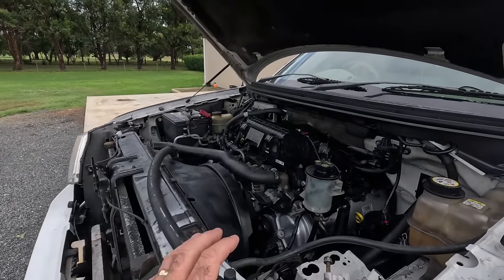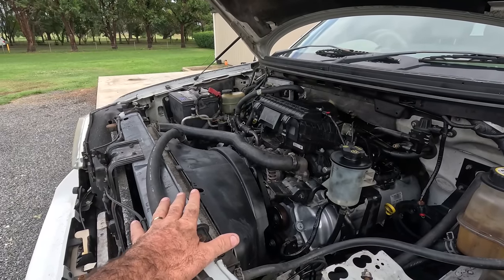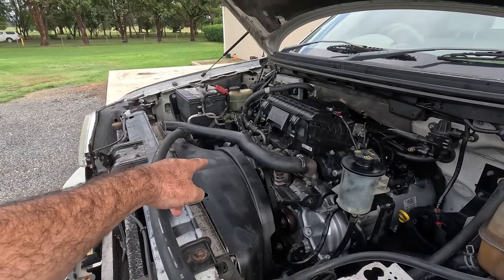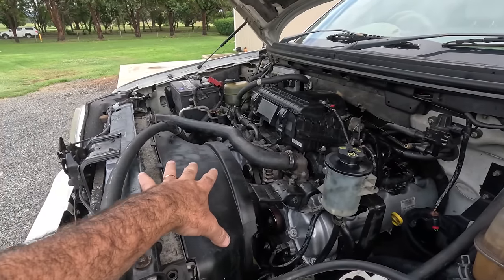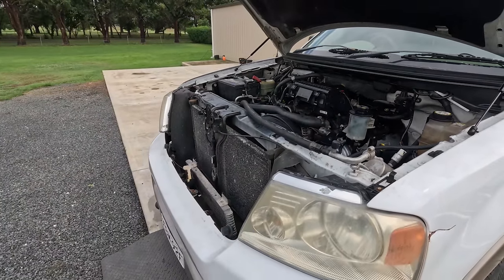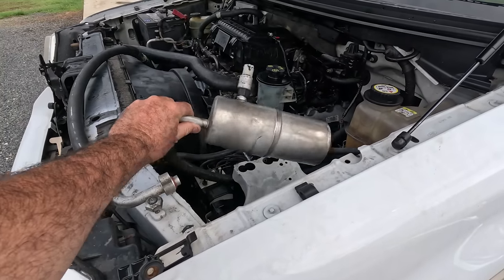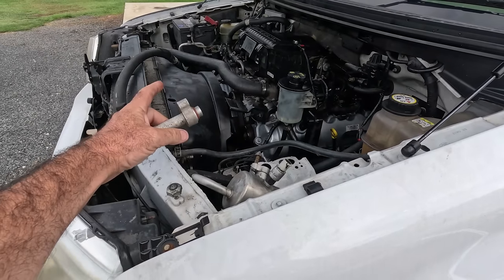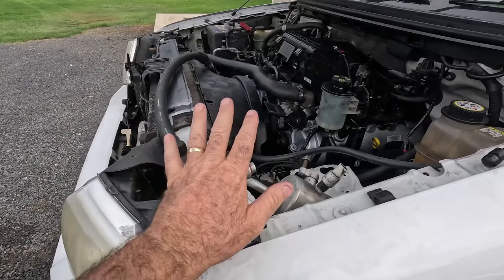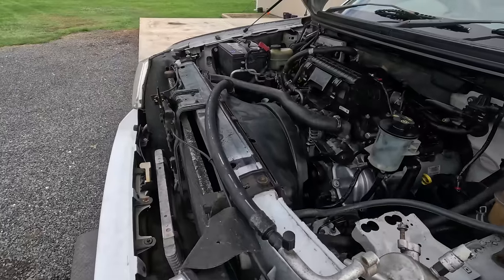Okay, so I spared you having to watch me put it all back together, but it basically was just following my list. So once the air conditioning compressor had turned up and was fitted, it was just belts, fan, shroud, radiator, and just bolt everything up. So we're now at the point where we can fire everything up. I've checked a few fluids. The only thing I haven't done up is the receiver dryer. I've got a new one coming to go with the new air conditioning compressor, but that won't stop us firing it up. So I'll leave that till after. Let's give it a hit.